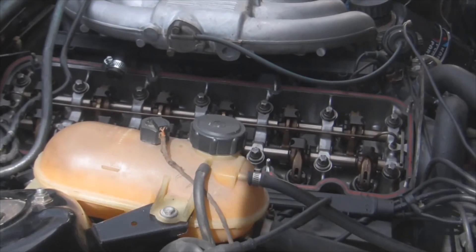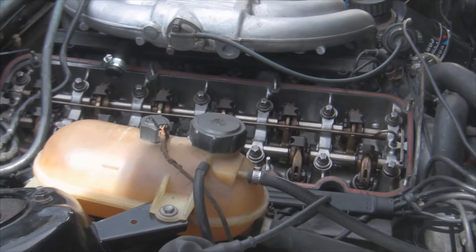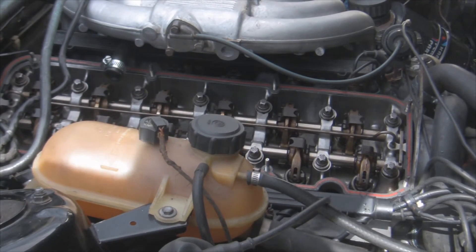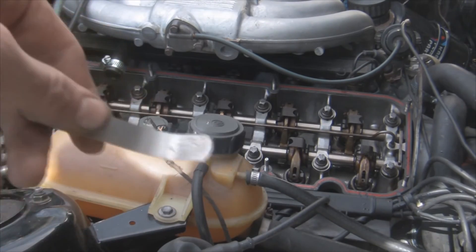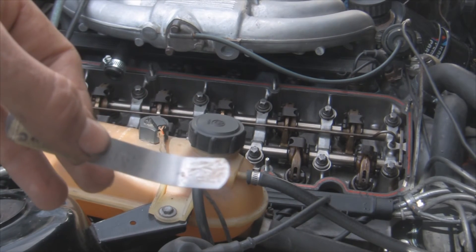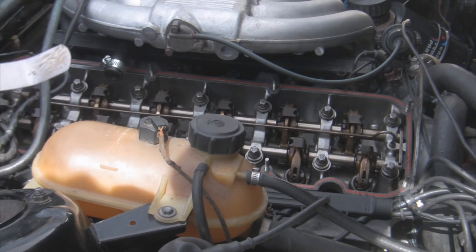Thank you for watching. Make sure you follow the firing order. Loosen the nut on the right or left depending on whether you're on intake or exhaust, adjust the valve eccentric with the .25mm feeler gauge, maintain that adjustment, and tighten the nut again. Then obviously put your valve cover back on.